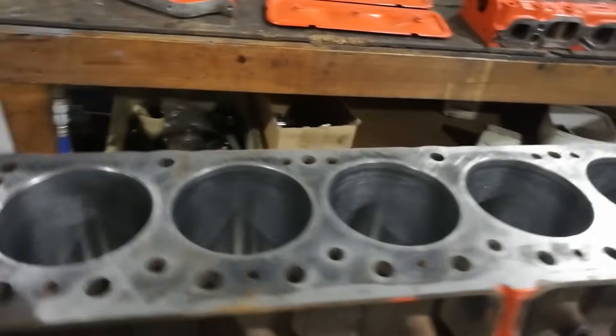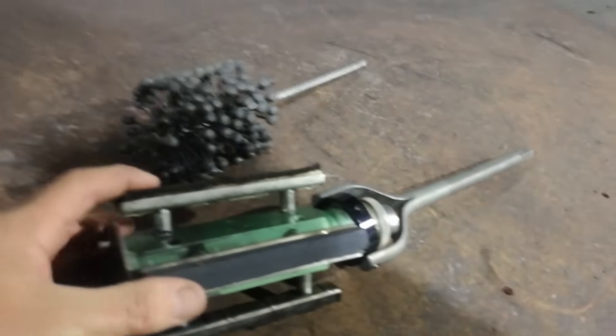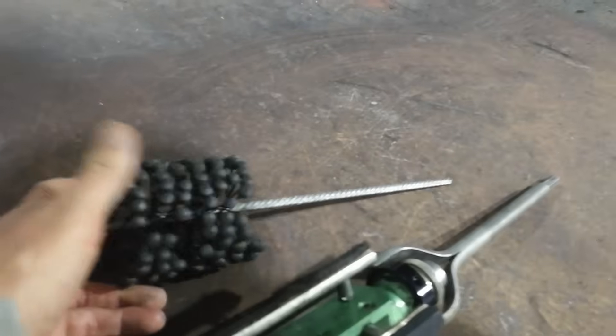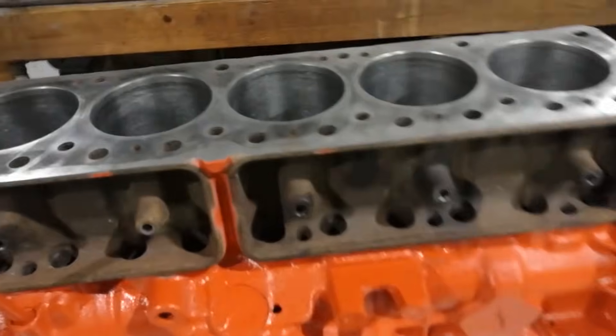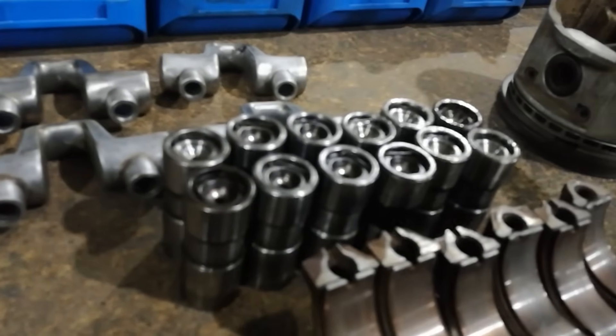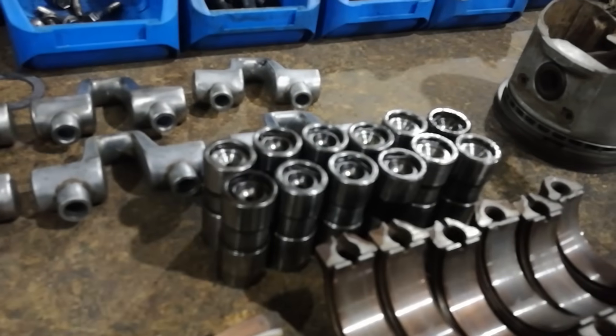I gave the cylinders a hone - I've got a rigid hone over here, there it is. I honed all the cylinders carefully and then gave them a bit of a polish with a ceramic stone. All good - cylinders came up well. There are a couple of spots with a little bit of pitting from surface rust, but it's very shallow and beneath the surface so I can live with that. The lifters are hydraulic - you can see them there. They'd had a lot of water and crap in them, so I was glad I cleaned them out. They probably wouldn't have worked properly if I hadn't cleaned them up.